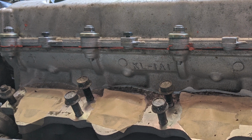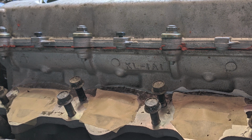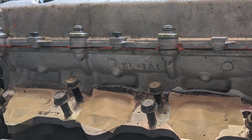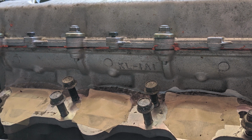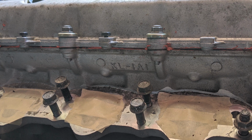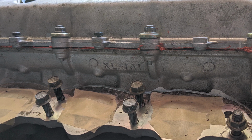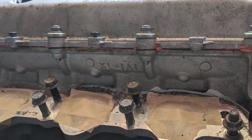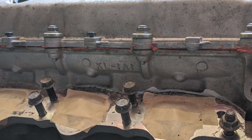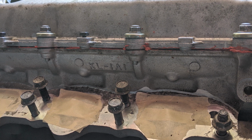After you finish the second valve cover, you're ready to begin reassembly. Remove the tape placed over the intake manifold holes and clean the surface off again to ensure there's no residue from the tape. Pull the shop towels out of the holes and give the area a quick vacuum to get any loose dirt. Pull out the manifold bolts and nuts and drop your new manifold gaskets into place. The cutouts in the gaskets should match the holes on the engine, so installation will be fairly obvious. No gasket sealant is required for this.